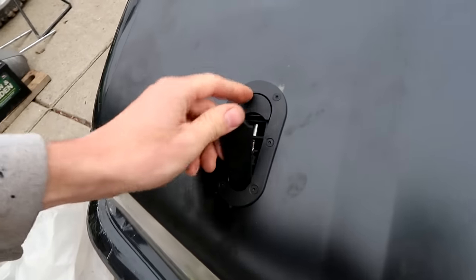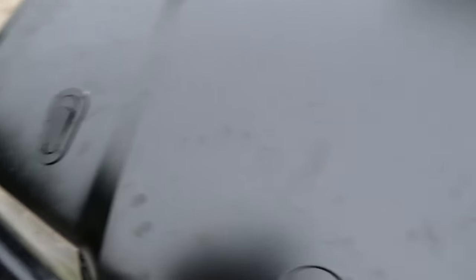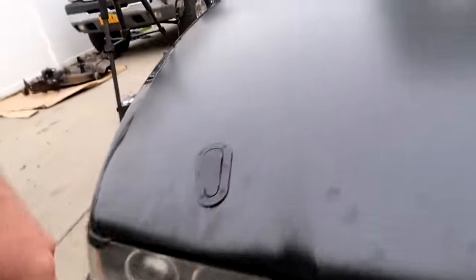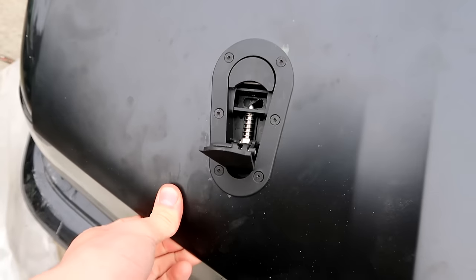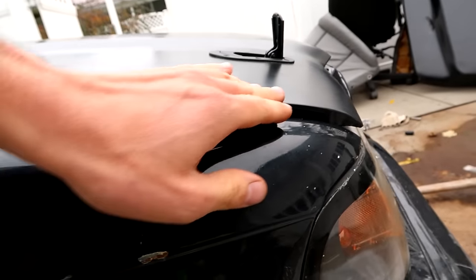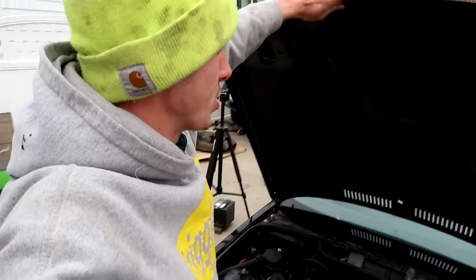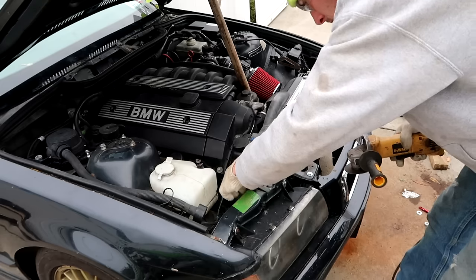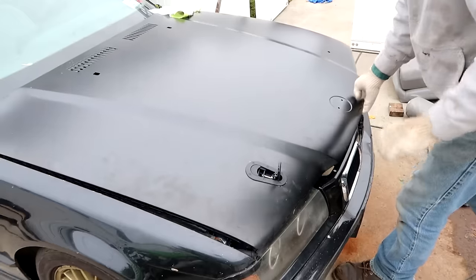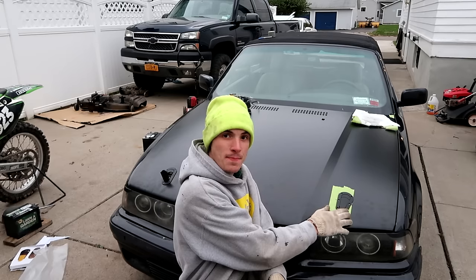We got problems. As you can see, I have this one mocked up — it looks pretty good. Granted, I have some etching that went over the edge a little bit, but that's okay. What is an issue is this hood has no clearance. When I put the hood down, it actually hits the bottom of this clip. So that piece of metal that runs across is actually hitting the bottom of this, so it's not going to close all the way — the hood looks like this, and that doesn't look good at all. Unfortunately there are no spots these clips would really go. At least there is clearance once I get it all hooked up. I have number two in its position. Now I got to drill the holes on this side.